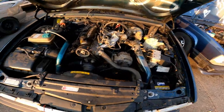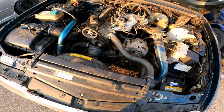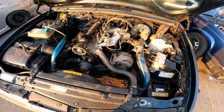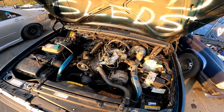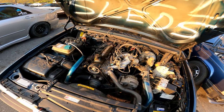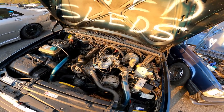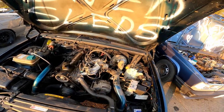We should definitely pull the lower crank pulley off, I think, and then take that belt cover off and just make sure there's no grit and dirt chattering around in the crank gear. This does have an IPD turbo camshaft in it, which makes this engine an interference engine, so you definitely don't want to mess with jamming up gears and that kind of thing.